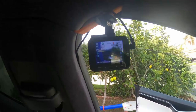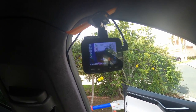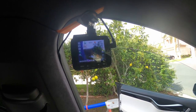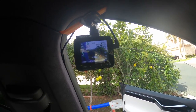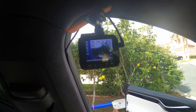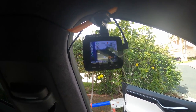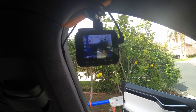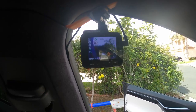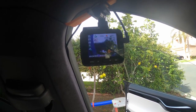The things I always check when setting up my dashcam: are all three dashcams set up to record at the highest quality? Are all the dashcams set up to record video and not some kind of time-lapse mode, because you won't get as high quality. Is the SD card inside? Is the sound on? You can see the sound recording is on, so I can read license plates if I don't think the video is going to catch the plate. Make sure the date and time is synced between all three so that if you're trying to match a left and front camera recording, it's easy to find by looking at the date the video was created. The date and time are in the file name, which makes it easy to match, but if cameras are out of sync it becomes very hard. Make sure the GPS is on — that can be really useful to know the location.